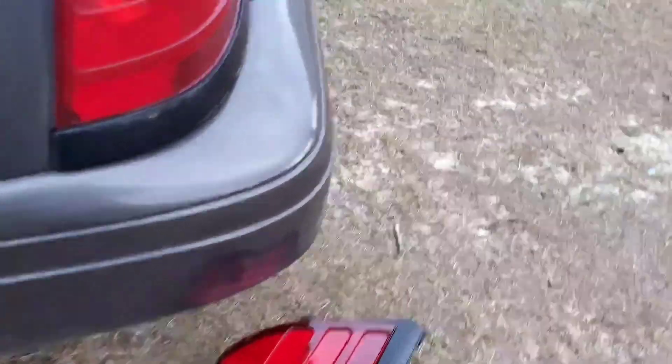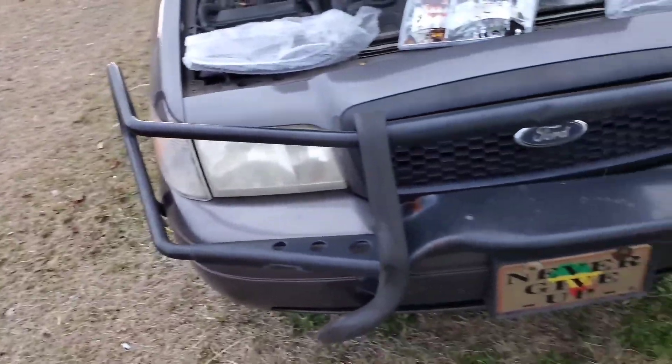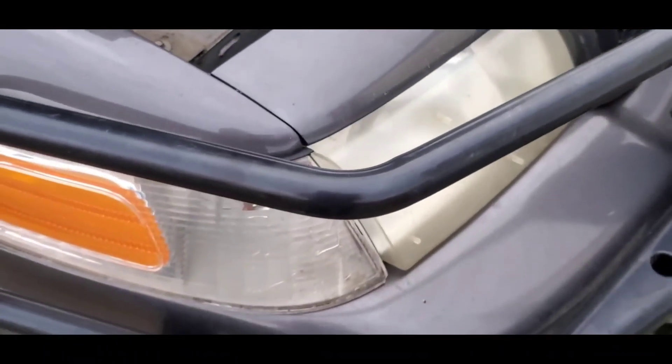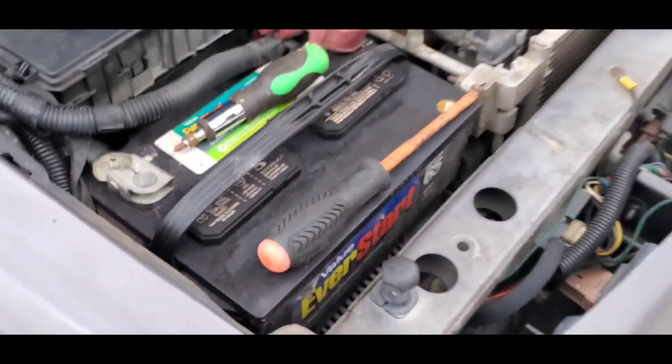Looks a little bit different. All that rubber on the side is worn. I'll just take it off that side and put it on the other side. Let me get to these lights — you got to see how terrible they look. On this particular model, it's got the retaining clips. Go right there and right there — trying to show they ain't never been taken out. Slide the headlight assembly out, change the bulbs on the new ones. They come with bulbs already, but I'm not going to be using those — I'm going to be using LEDs.